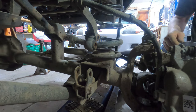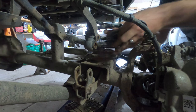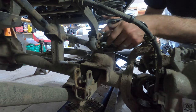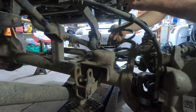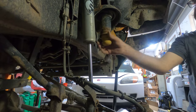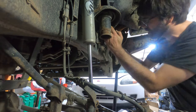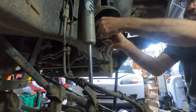That was pretty easy. When I put them in originally I had to actually zip tie it to the spring to be able to get it in. So now I should be able to move this shock and spring out just like that — take it out completely. Now it's going to be a question of removing the stock bump stops. I'll move the sway bar a little bit higher up so it's out of the way, then take off the spring isolator.